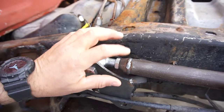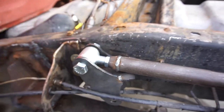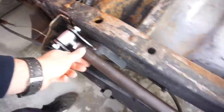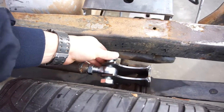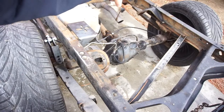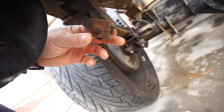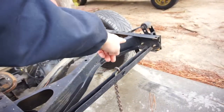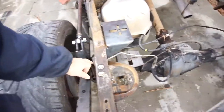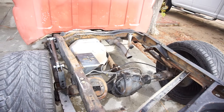I'm gonna grind as much material off as I can and then TIG weld it so it looks cleaner. A guy at work who went to TIG welding school told me how to clean it up after I sent him pictures — he said I could make these and sell them. I'm gonna take the shock perches off, the crossbars off, there's a muffler hanger over there too — take those off — then drill or grind the bump stops off. It's looking like I might have to get a fuel cell.